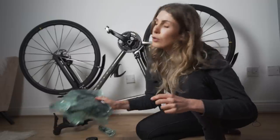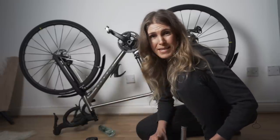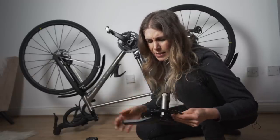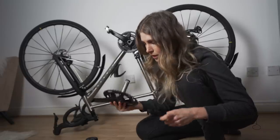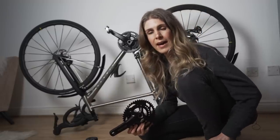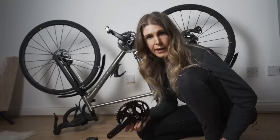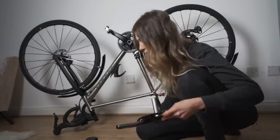Just bear with me while I change the cranks over. Crank size is personal preference, but I prefer the shorter I can get. I've got a power meter on this which is 170mm, which I'll be taking off. The GRX that I've got for this is the lower-end one because it had a smaller chain ring, and I've got it in 165mm. The reason is it's just easier for climbing — the circle you make is slightly smaller and I was basically getting sore hips. Having shorter cranks really helped that. So if you're getting sore hips, think about your crank length — it's not really related to your height either. I'm like five-nine, five-ten and I'd go 165 on every bike if I can.